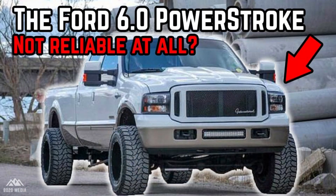We did do a video somewhat recently discussing reliability on the 6.0 Power Stroke where we probably said some not-so-nice things about the overall reliability of this engine, and that becomes important once we start talking about performance modifications because adding additional power and tuning the engine will really open up the weak points. I recommend at least having an upgraded oil cooler because the oil cooler is the one thing that leads to a lot of the problems on the 6.0 Power Stroke. By upgrading and fixing that we can reduce a lot of the reliability issues and make it safe to mod and tune the 6.0.